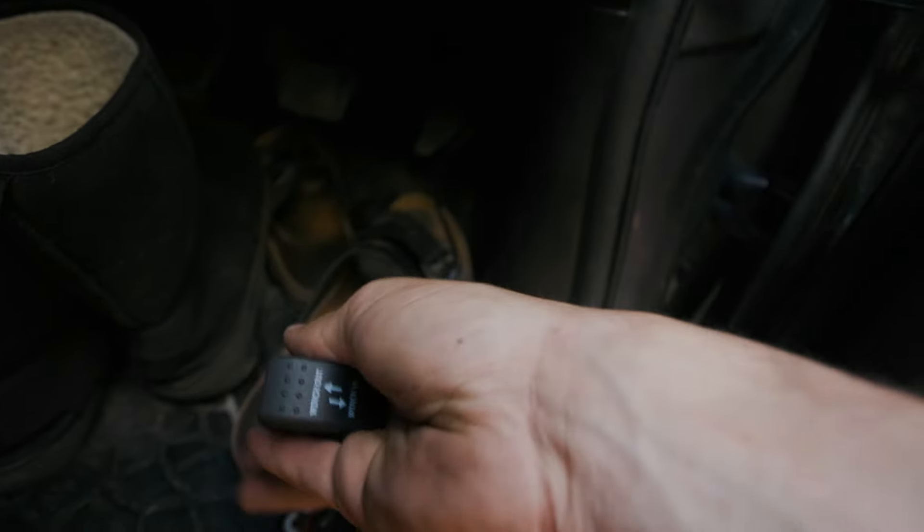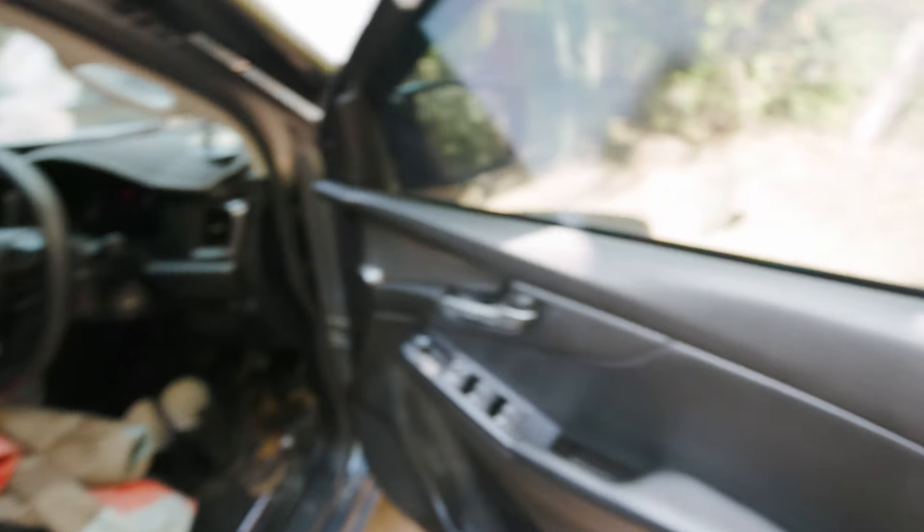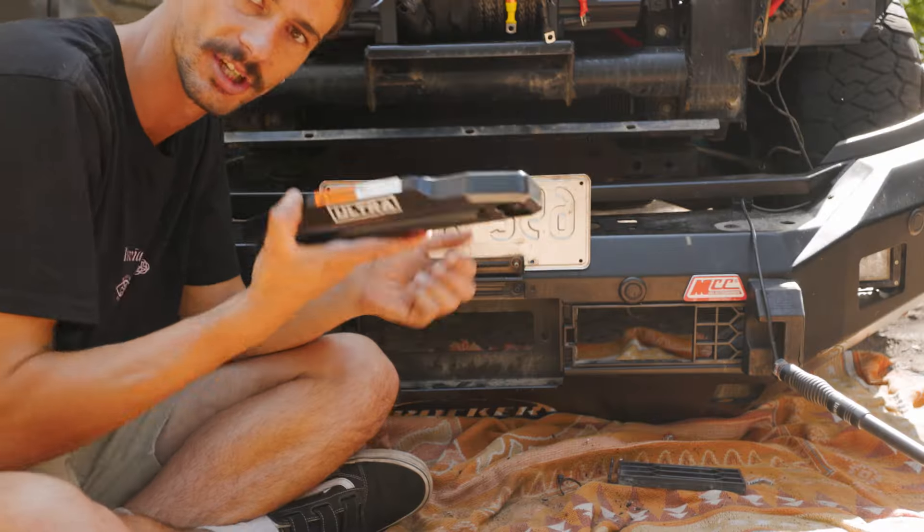We're going to put the bar back on because if not it's going to be really tricky to maneuver around. I've ran the cable and disconnected the other half — that goes through to the cab. But I broke a prong off the rocker switch, so I'm going to have to source a new one. Now on to the next step.